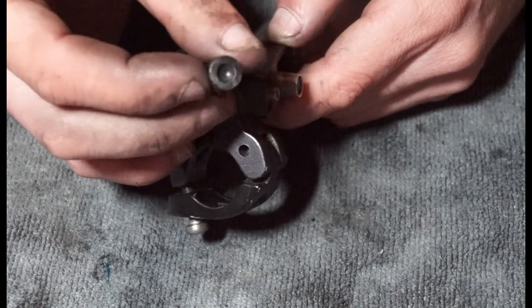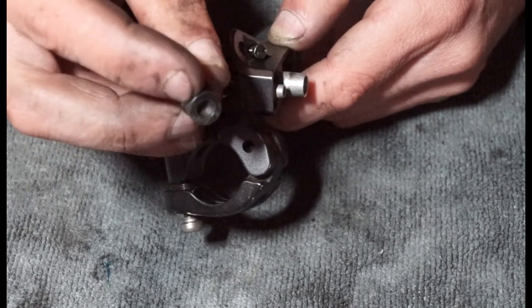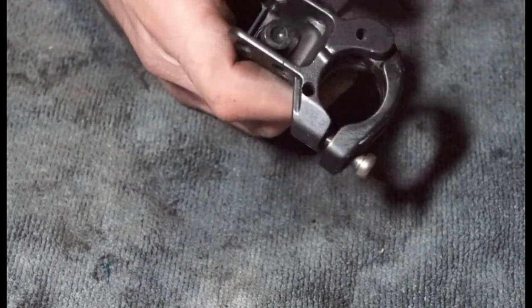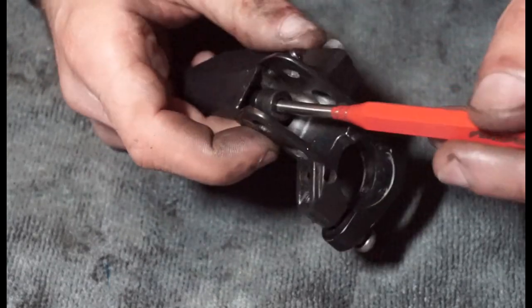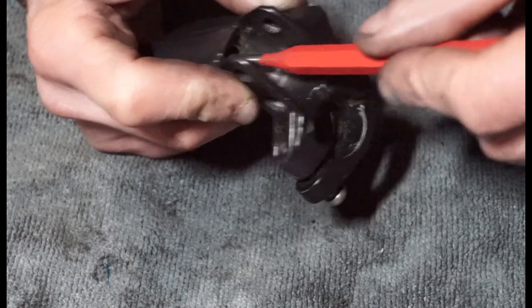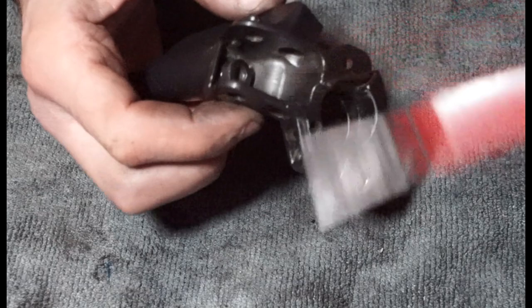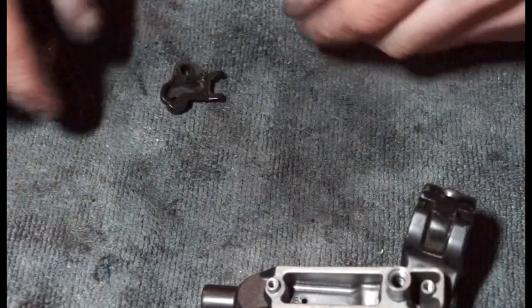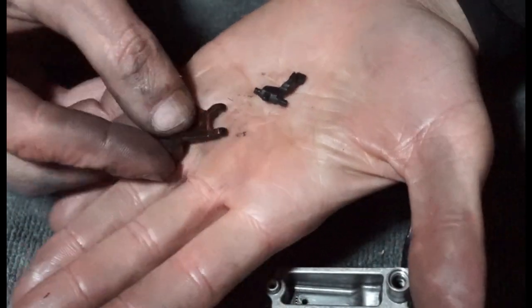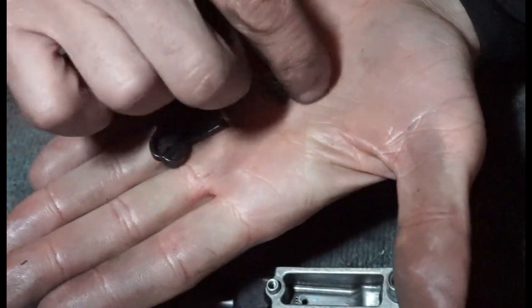And it's quite easy because that dipped area there is facing out, because the plunger needs to sit on there. If you wanted to, you could put mineral oil on the seals before you push them in. But these seals don't look like they're swollen and they seem to move quite happily. And then what we're going to need is this plate and this lever as well. So these two items. And if I show you now, that's going to sit in the brake like that, downwards.